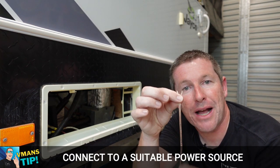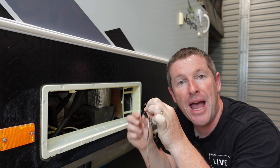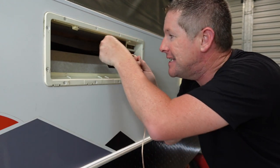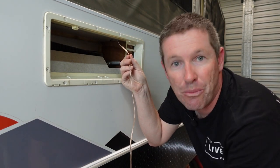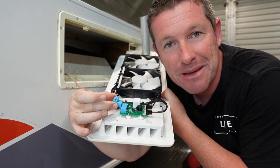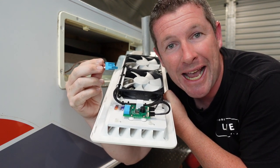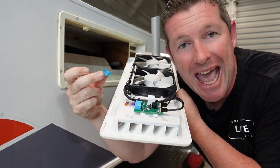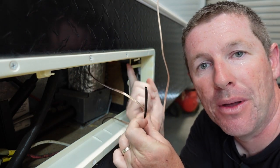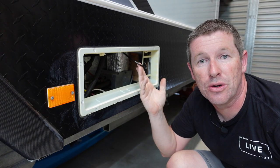Put a little bit of electrical tape around the top and feed it through, then pull it through from the other end. Since our fans fit into the upper vent, it's a simple case of getting your cabling and feeding it down so you can pull it through to the bottom and run it through into the back of the battery box to link into the CTEK unit. The plug-and-play nature of this kit means it's incredibly easy to simply unplug it if you ever need to take the vent out for servicing or to gain access to the rear of your fridge. I'm also going to put the included sheathing around the cable that runs up through the hot section of the fridge to the top vent, for a little bit of extra protection.